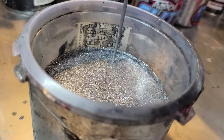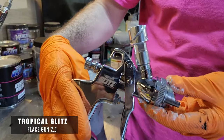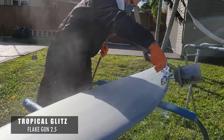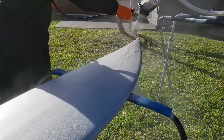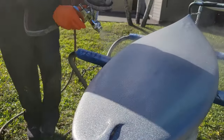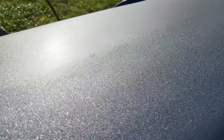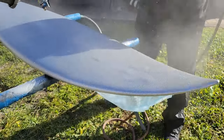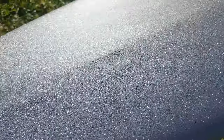We're grabbing our 2.5 flake gun. Same process as before — I'm going to shoot this like I'm shooting base coat, with a 50/50 overlap, six-inch fan, six-inch distance. That's one pass of our Platinum Plus right over that board — and that's the exact results you should be getting with your metal flake paint job. If you're using our product with our tools and mix ratios, this is exactly what you should be getting. We'll come back and do another coat — you can never have enough flakes. We give it a little drop coat, and that is straight inner coat with our Platinum Plus flake, no clear.